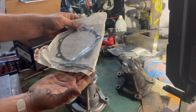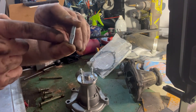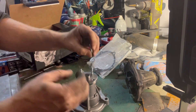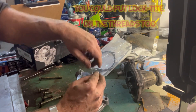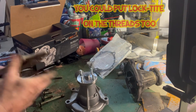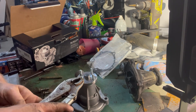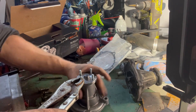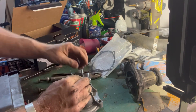When you're putting these fan clutch studs in, the shorter threaded side goes into the water pump; the longer threaded side you're gonna need to put onto the fan clutch and get the nuts to have any room to bite on it. We're gonna snug these up just with some vice grips, because you don't want these being wobbly and backing out for any reason. You could also use jam nuts to do this. I think we've damaged the lower threads enough — seems to be in there.